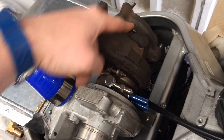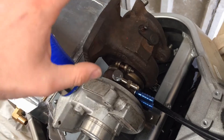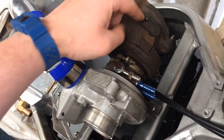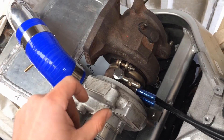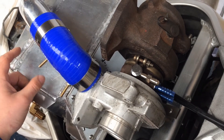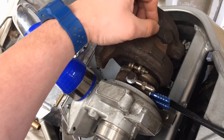The problem is the wastegate's there, the actuator sits here, and when I put the tank on top the actuator hits the tank and I can't fit the tank on. So the plan is to have a bar that goes from here to here, have a little leverage mechanism, then have another bar that goes down here, and have the wastegate down here so it pushes that open and closed.